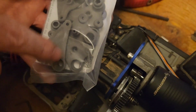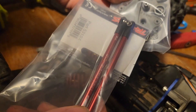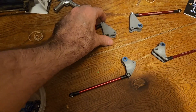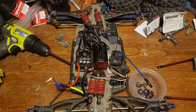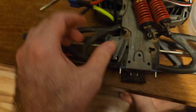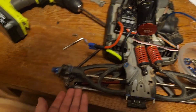So we're gonna go ahead and take the bearings and put them in. While we're at it, before we have to fiddle around all in the truck, we're just gonna go ahead and attach these to the correct side of the rockers. The other way, all we gotta do is set them on there and bolt them down. We've got all these assembled and ready to be put on the truck — rear ones here, front ones here, laid out exactly how they would go on the chassis. Just take these, feed the little rod through there, move the shocks out of the way, and they fit on just like that.